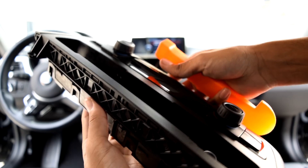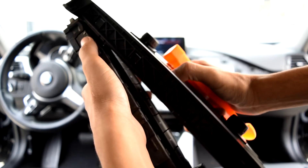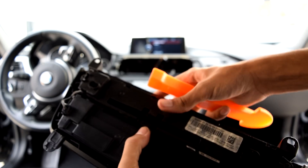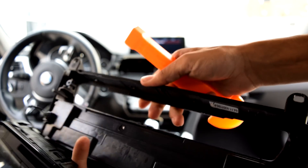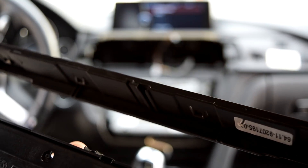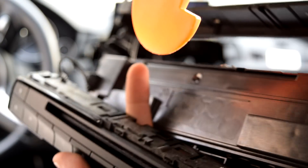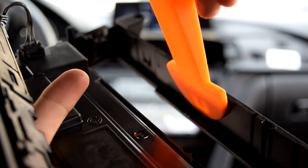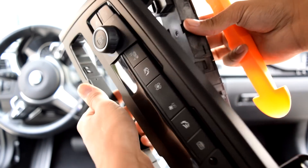To remove the radio and climate control out of the trim piece, you have to unhook and unclip these clips right here — they all clip in like that. You take your trim tool and basically shove it in between the trim and the radio piece itself to get these clips off. If you look closely, right here and here there are little clips holding the radio piece in. What you want to do is try to get them off these hinges because that's what they're clipped onto. You just have to kind of shimmy the radio piece out, and do the same for the climate control.